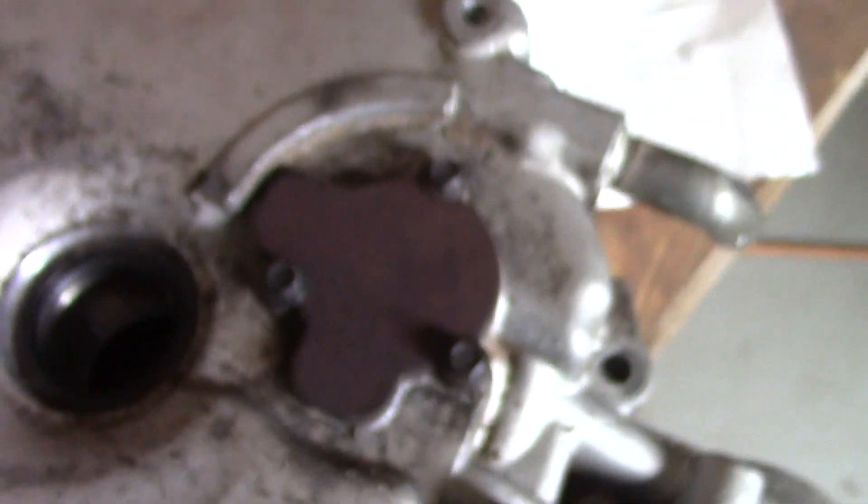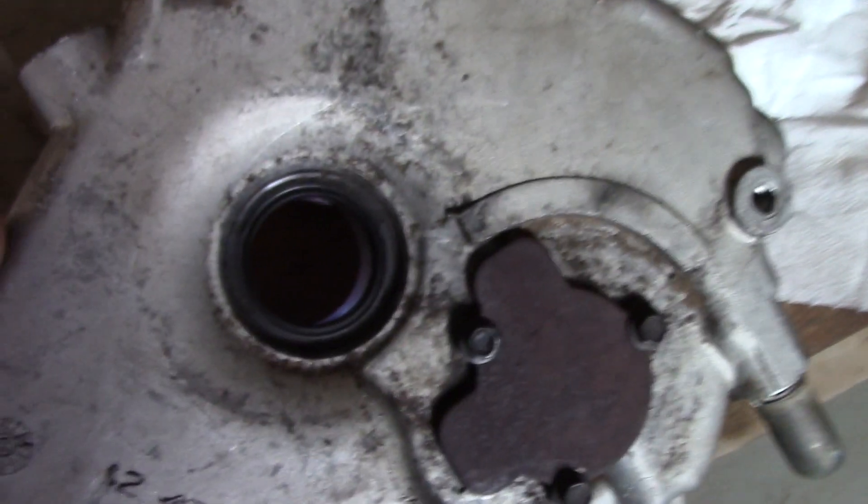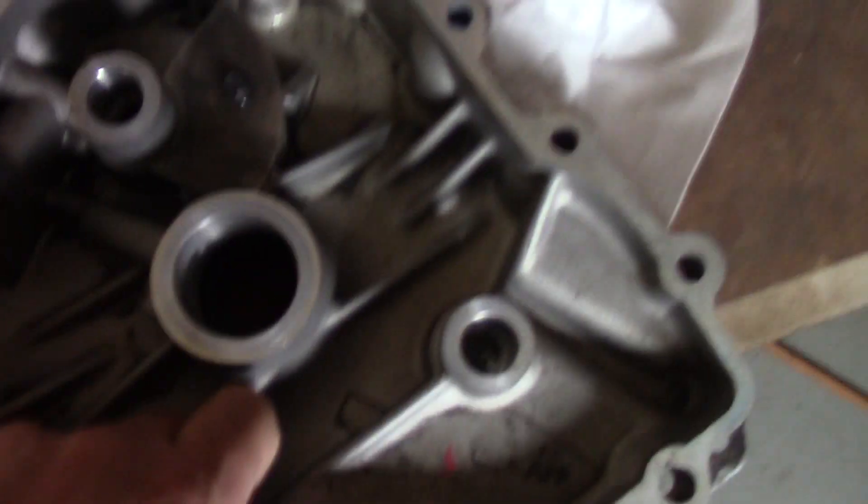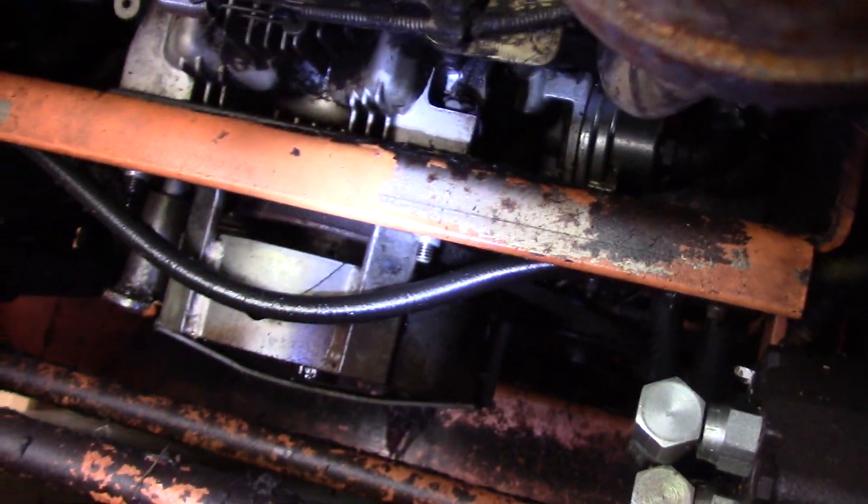Before I put this on I'm probably going to have to order a new oil seal too - it would be pretty stupid to put it back together and find out it's still leaking. That's also the problem with this rider here: the oil seal is bad and it's leaking off the bottom shaft. I can't even see it on camera, but there's leakage right in that area.